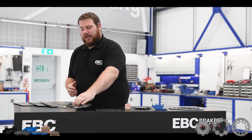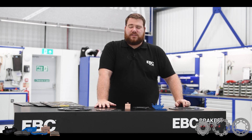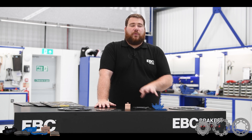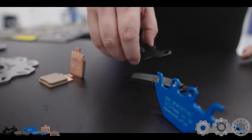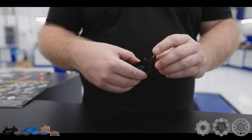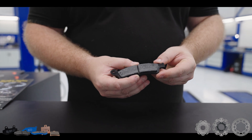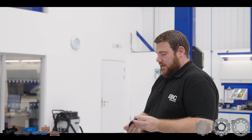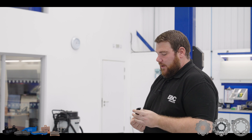The hub is made of stainless steel as well, and then we paint it black. All of the discs use 420 stainless steel. The stainless steel is hardened and we use a stainless steel that's been specially selected to work with our pads. Speaking of pads, these are our organic range. Our organic range are direct replacements for OE. They are an aramid fibre, they've got zero toxic ingredients, and they're suitable for all sizes and styles of scooter and brake disc materials.